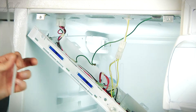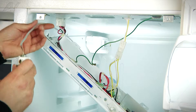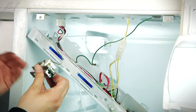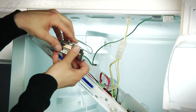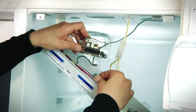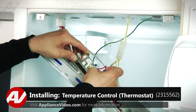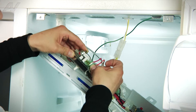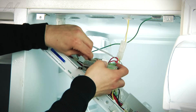We're going to take the thermostatic bulb and we're going to slide it back into the unit. We're not really worried about where it's going right now because we're going to attach that after we put the thermostat back on. So once we have that back in there, slid back through, we're going to take and reconnect our wires. With your wires, get them slid onto your thermostat. Find your ground wire again and put your ground wire back on.